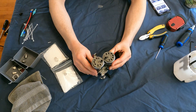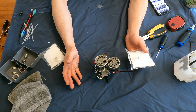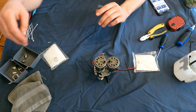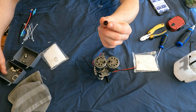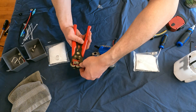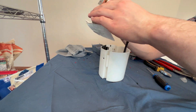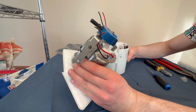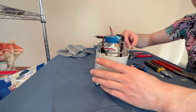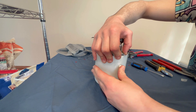Now that our fuel pumps are zip tied in place, we're going to put on our fuel socks and then set this into the bucket. We're going to attach our bracket to the bucket and then get started on our wiring. The nylon grommets that come with the kit — take this and jam it in there. Using wire strippers, we're going to give these a quick stripping. It was definitely a tight squeeze dropping everything into place, lining up the holes and inserting the push clips.